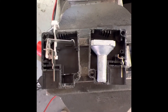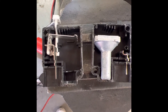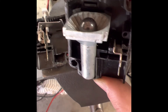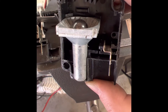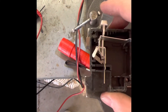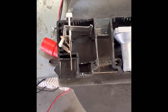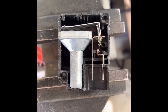Once apart, it'll look something like this. It's a two-contact setup — the resistance through it will be low, creating continuity. This is where the inertia part comes in: this little ball will bounce up whenever there's a collision at the rear of the car and shut off the fuel pump. It's a pretty simple theory of operation — a spring-loaded mechanism and a reset arm.